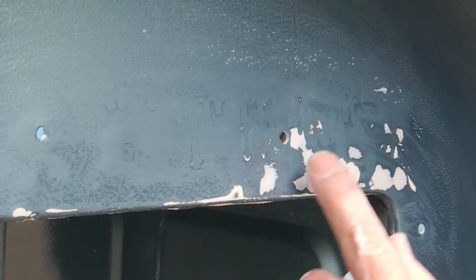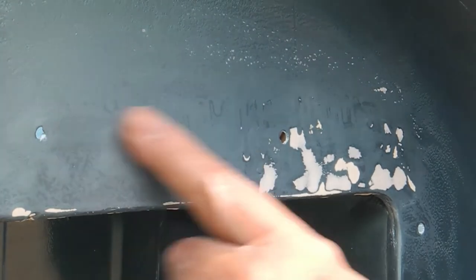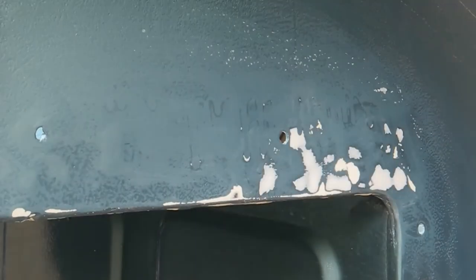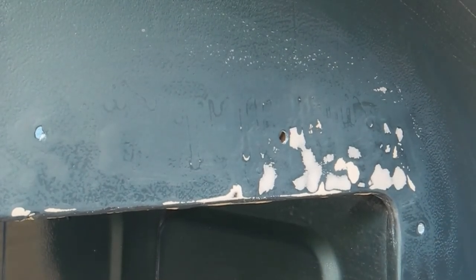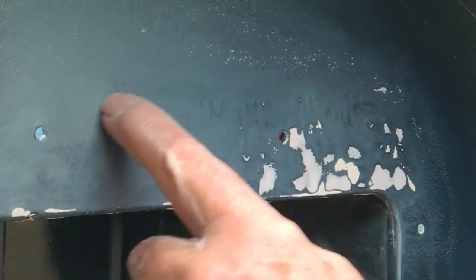And the awkwardness is that it's a bit bumpy here, because this is the original, 100-year-old panel. Not quite, but it's the original wheel well. And it's bumpy. It's a bit bumpy in all this area here. So if I did that on an outside face, on an outside surface, on an outside panel, they've got to flow very well. And you wouldn't get any of this sort of stuff, because that'd be dressed out long before it gets painted with various fillers and so on. So from along here, I need to respray just this area here.